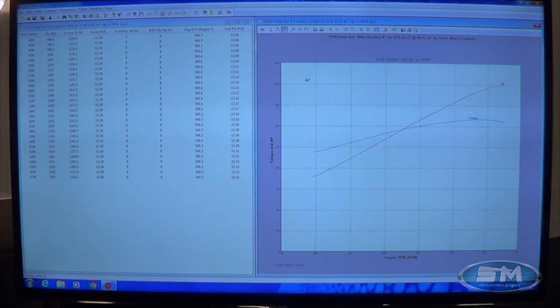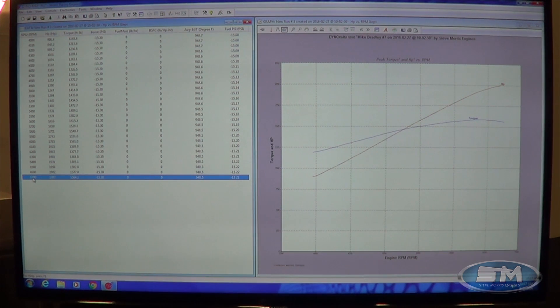Alright, as we can see here we are pulling back just a little bit short. With this motor and the F2, Mike wants to get used to it — he already had the F2 — so it's just a little bit of a compromise. He'll be putting the F3 on it probably next year after he gets a handle on everything. That's why it's short on RPM: we basically run the blower right out of air because of the engine size. But still real good — 6700 RPM, pulled back just a little bit short, 1997 horsepower. You can see here in the graph that peak torque was right up in that 6300 area and starts laying over.